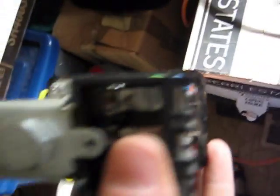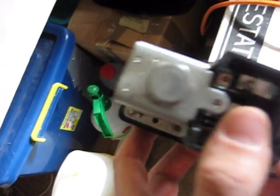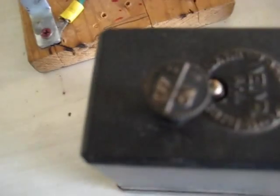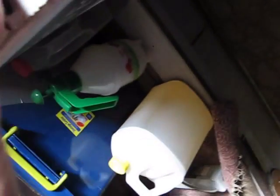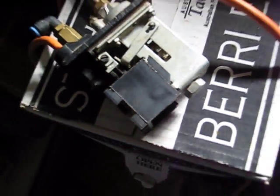Wiring it up, looking down from the top, those wires have to be pretty neatly packed away so the cover can go on. Got myself a washer - I've got to try and sit that on top, which allows that cover to be screwed on without being crushed in. Because if it's screwed down too tight without that washer, that switch doesn't work. All that switch does is hold it - you push it off by pushing it down, it will hold the contact open. You can press it switched off.